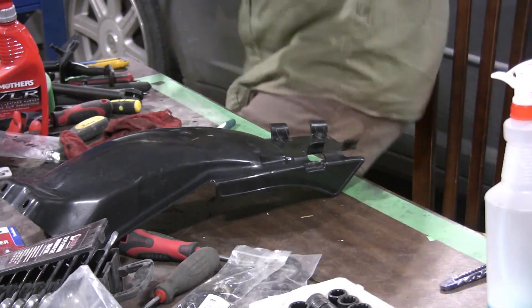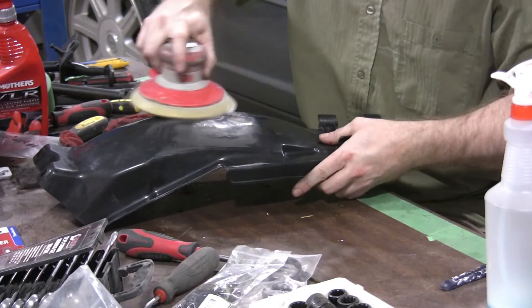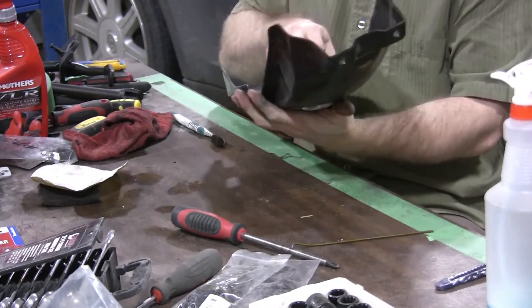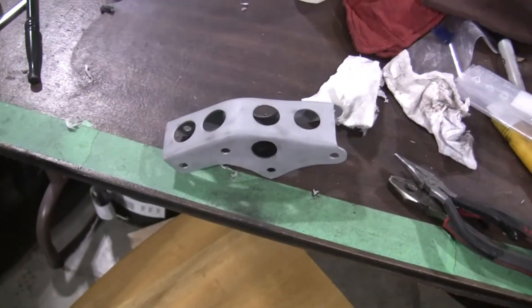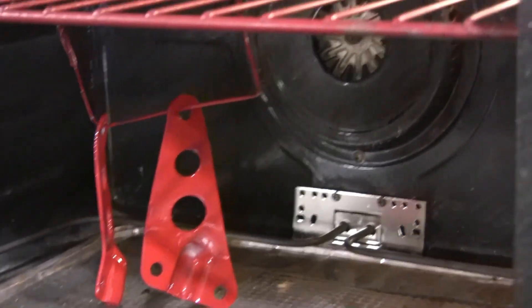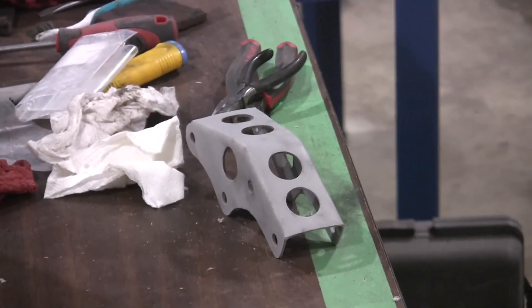That's a handy little tool — thanks to my brother. Well, that's prepped enough until I see where it's going to get cut. At least it's not dirty anymore. I got to sandblasting some of the engine mount parts and they're looking pretty sharp. I went ahead and powder coated a couple of them red, and they're just about done baking. The new element here is doing really good — it warms up really fast and gets the parts nice and warm. But I don't have enough powder to paint this piece as well, so I'm going to have to wait for some new powder to come in before I get to tackle that.